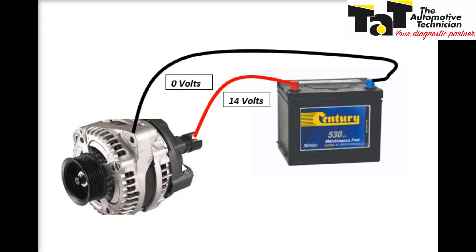All the voltage must be used within the circuit. So, how do we carry out a voltage drop test? We're looking for a potential difference between a high point and a low point. We would normally measure the voltage at the power source compared to the load, and then subtract the two — that would give us our voltage drop. But there's a simpler and more definitive way of doing that particular test.